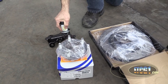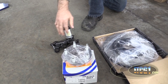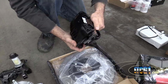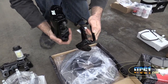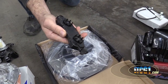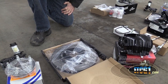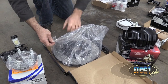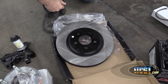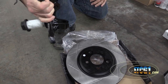I have new spindles and hubs that are different from the ones on there now. The ones on there now are an older style that have the bearing integral as part of the rotor assembly. What I'm doing is upgrading to SVE dual piston calipers. These are loaded calipers — they already have the pads as part of them. I've already thought about where I'm going to find replacement brake pads. These are slotted 13-inch rotors — pretty massive brakes that are going on. Here's the five-lug conversion, and these are the spindles I'll need to make this happen.